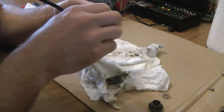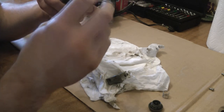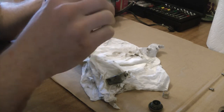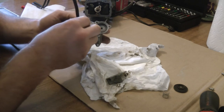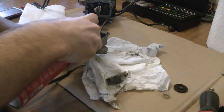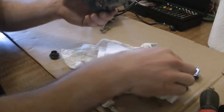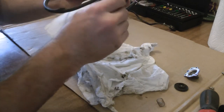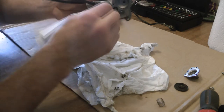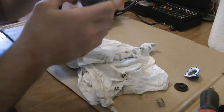With this little diaphragm here, I'm going to pop that out — just make sure that it's not cracked or there are any holes. From here, I'm going to toss the plug back on there, and then get a good amount of cleaner in here. After you've sprayed a little cleaner in there and got most everything cleaned out, rinse it with some parts cleaner. Then I'm going to run out to the shed and blow out some of these.